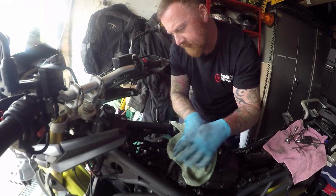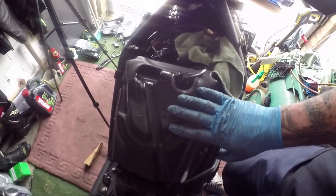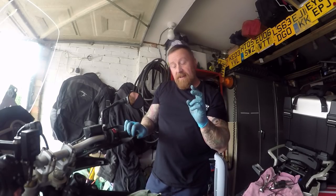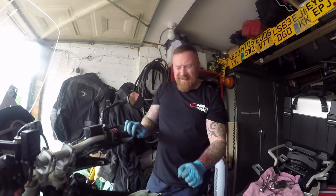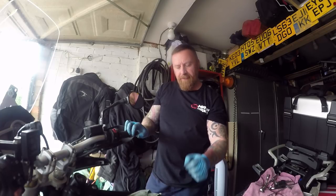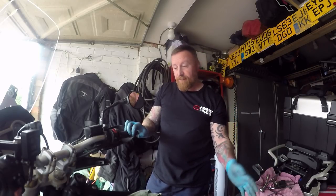There you go — one very heavy petrol tank. I have said this before: try not to fill your petrol tank up. Now I wasn't expecting the plugs to come so quickly — which they did. Here's the little connected bit I'm talking about; you needed to push these two bits in — a little bit of petrol and there's a little clip over it, that's on the tank still, so you have to push that off and then try and get these two bits pushed in. It also comes with these two little connectors and these you can just squeeze down. Here we are — one, two, three plugs. Air box and the water. I'll give the chain a look at and spruce up as well.